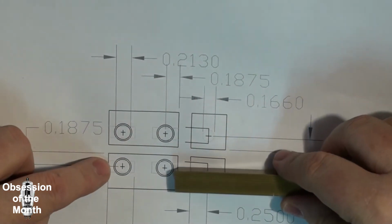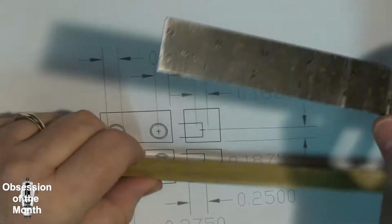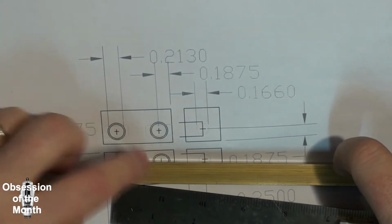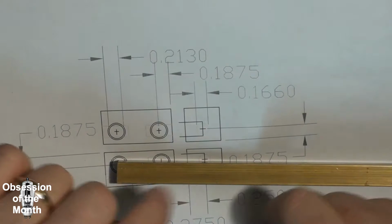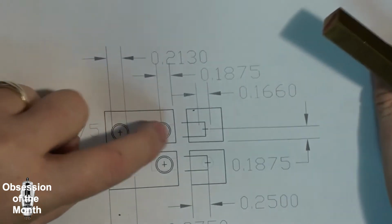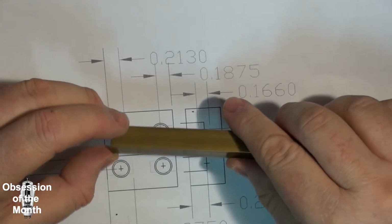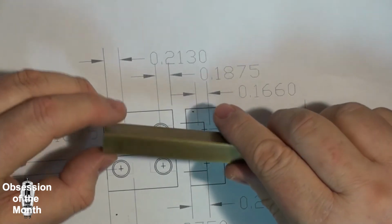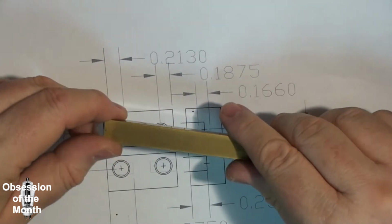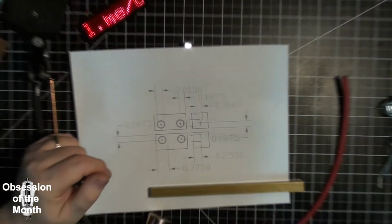These are 1 inch long, and then comes drilling the holes and tapping the screws. Tapping these two screw holes is going to be interesting because I may have to drill all the way through it. I don't have any bottoming taps. I just have normal taps. We'll have to see. I may end up having to buy some.